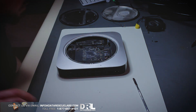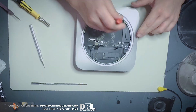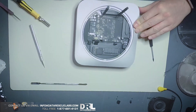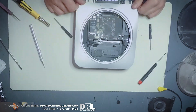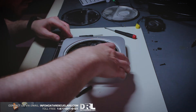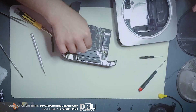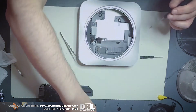There are a few more screws — not hidden but kind of hard to spot. I'm going to unplug the drives and use two screwdrivers to push the motherboard out. The motherboard has to come out to get to the drive — you really have to pull everything out including the power supply. The last thing to remove is the cable from the power supply, and once that comes off the board is free. Then the power supply comes out.